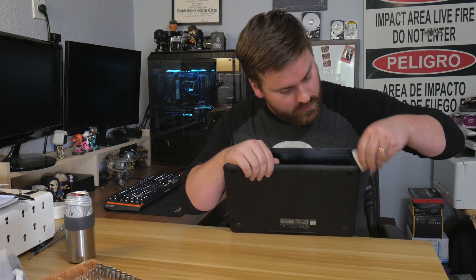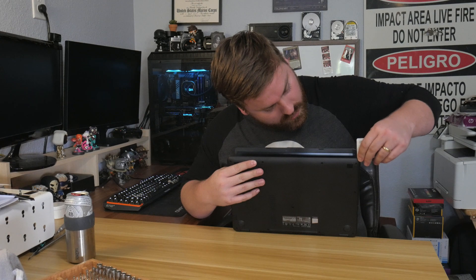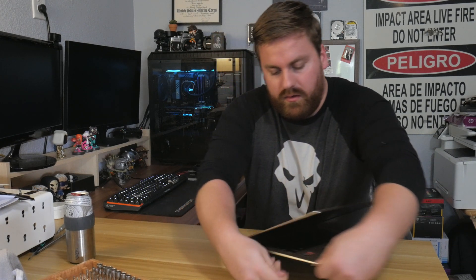Okay, so what you do is begin to separate the keyboard from the laptop body. I'm going to grab a card or something to get in there and unsnap those clips. I think last time I had a little bit better luck going in from the corners. It looks like that's going to work. So I'm just going to run it around the perimeter of this panel.